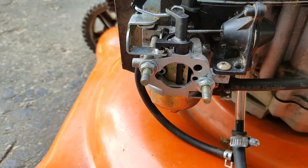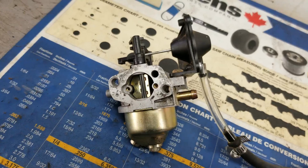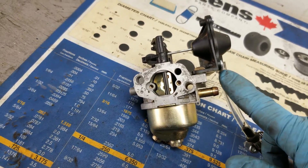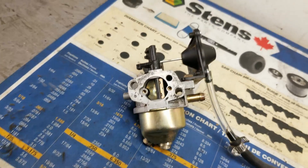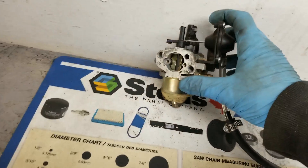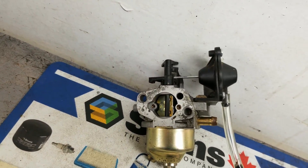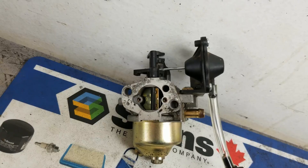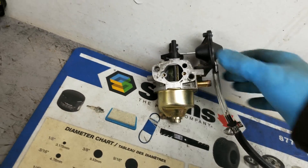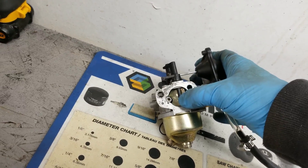This choke plate is not opening, so I think we've got a bad diaphragm assembly here. Now over on my bench I have a separate carburetor with a diaphragm assembly and my pressure hose hooked up. I'm going to provide some vacuum pressure — just watch this arm coming off the diaphragm assembly — and as I provide the vacuum pressure you can see how that's getting pulled. That's what it's supposed to do when it's running: apply that vacuum to pull the diaphragm assembly across to open that choke until it warms up.